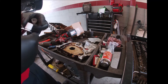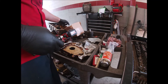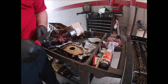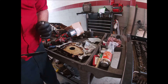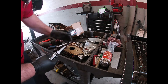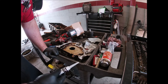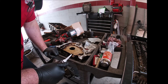You don't want to overdo the Honda Bond — you don't want to put so much in, especially around here where it could go through the O-ring into the oil pressure passage. Just be conservative with it.